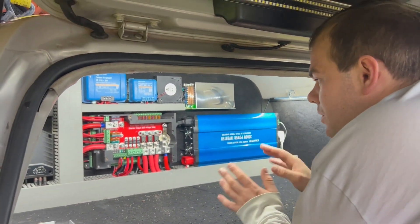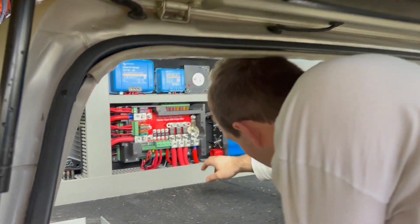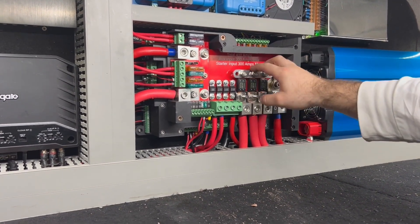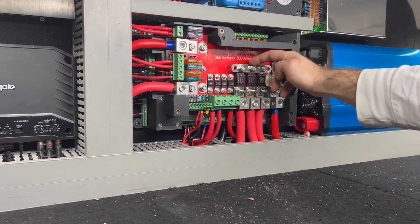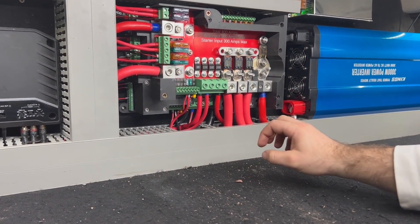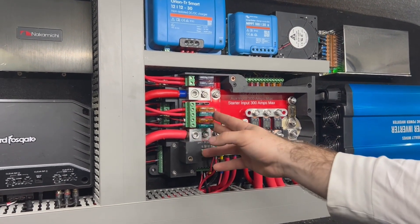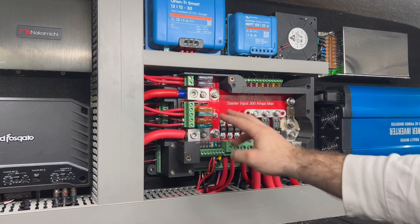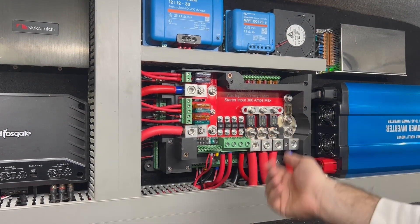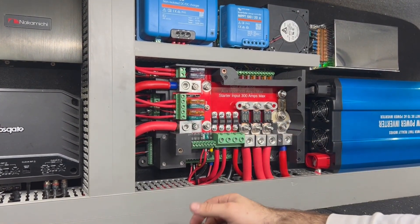You can't keep it at 500 amps, but I've done some upgrades in the background to fix this. This bus bar here will be removed — it was just a temporary measure to see if it would increase capacity, and it does. I'm going to fix it so the bus bar goes on the bottom and the fuses are on the top. These are going to be raised up a little bit to accommodate. Instead of going 30% thicker in the copper, I just went three times thicker, so we're not going to have a problem with these heating up too much.